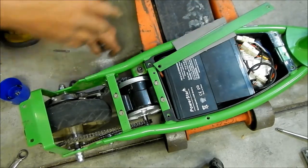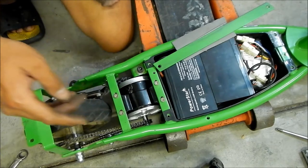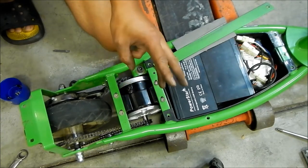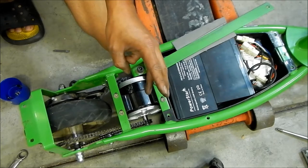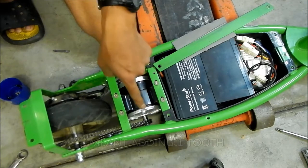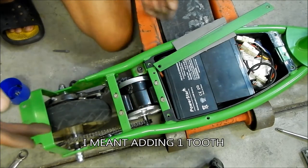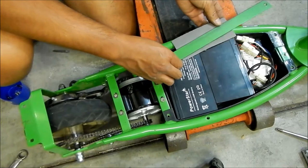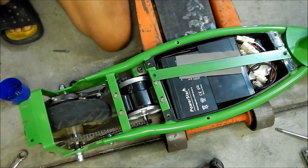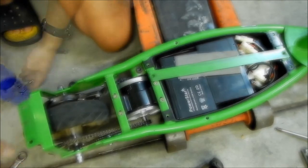We have more power and more speed. Just in case you don't know: for a motorcycle, when you go up or down a tooth on the front sprocket, it's equal to three teeth in the back. So it's like we went down three teeth in the back by gaining one tooth in the front, and that gives us more top speed. Hopefully we can go at least faster than 10 miles an hour. I'm going to go ahead and reassemble the scooter — I'm going to speed this part up. I have a couple other videos where I show you how to do it, but it's pretty simple.